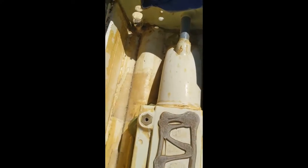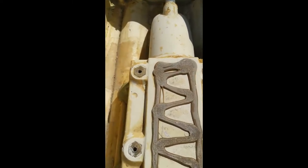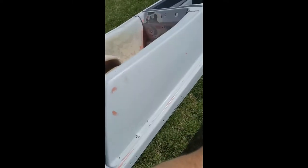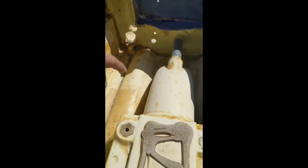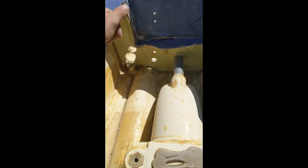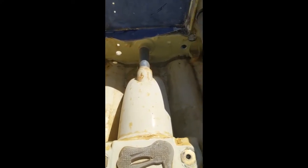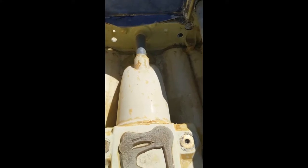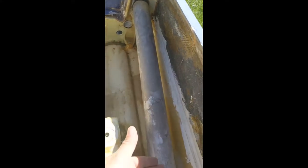So what about the inside? I'm just going to go ahead and mute myself here. So the insides are identical. Everything that you're seeing here is the same. Yamaha did make some improvements over the years of filling all the holes better. For instance, this model of round nose, compared to the one on the left, they did a better job of putting kind of a goop or an epoxy over all the holes on the round nose. So if you do have a square nose, when you do cut into the hull like this, you'll want to be putting epoxy over all the holes. But other than that, the inside of the round nose is identical.